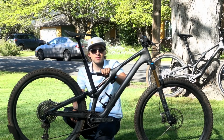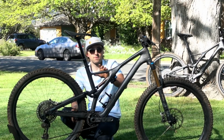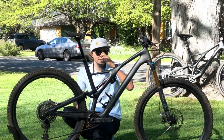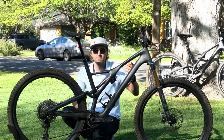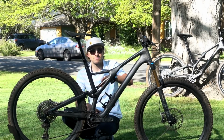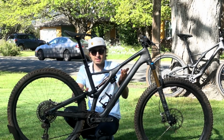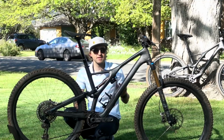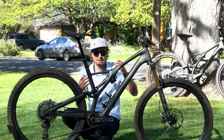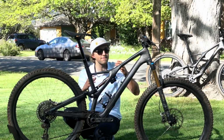Previously on your bike, you'd be out shredding hard, you would get frame flex. As the suspension would compress, you could be getting upwards of 17 millimeters. That's almost a full inch of frame flex, right? That's undamped suspension squish. You're just giving it away. It looks similar to a Demo, serves a different purpose, but gives the frame a very robust, stiff chassis.